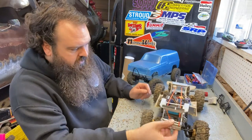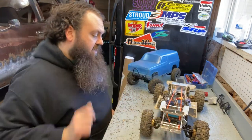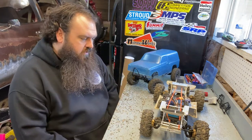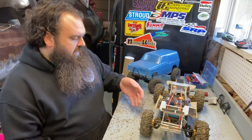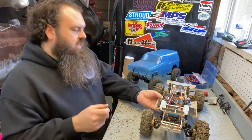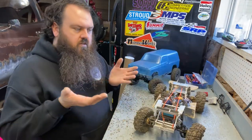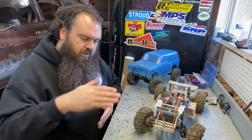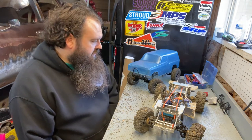I made this little front bumper. Got the DSM winch on there. This thing has a 3,800 castle, geared all the way down as low as it'll go, with the two-speed. I have aluminum sliders that I had on the Ford body, but I chopped them off to fit the Colorado. And then I made this little whale tail thing that kind of sits under the rear so it slides — almost like a slider. It slides up into the rear bumper and the bumper sits right above it. Worked really well. I didn't get hung up on anything.